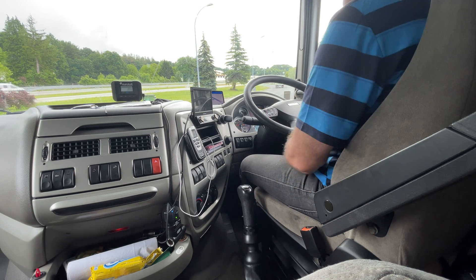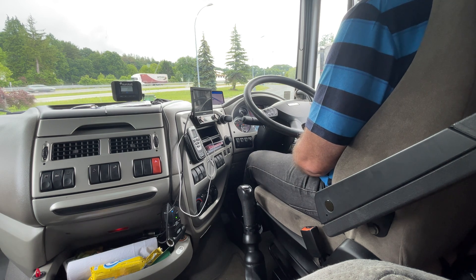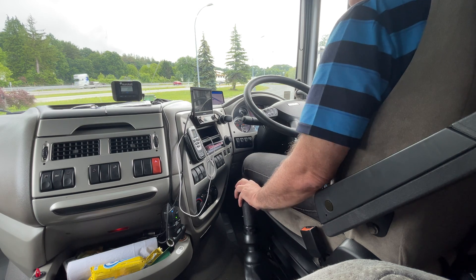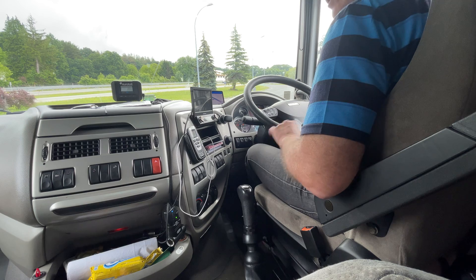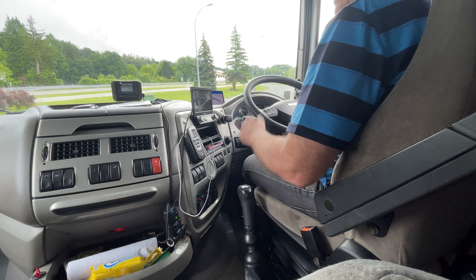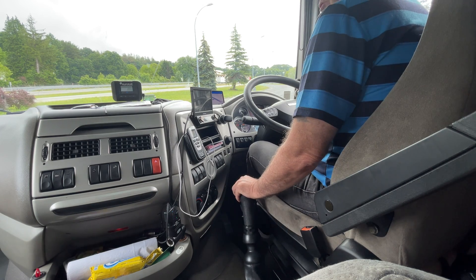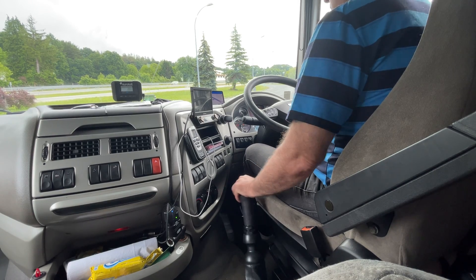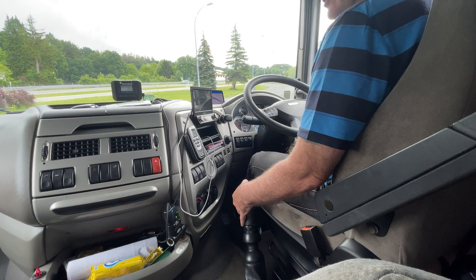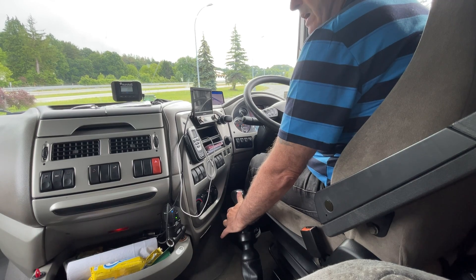You can pre-select the splitter and it won't activate until you press the clutch. So you let your revs die down and then it drops into low gear. You have to remember that it is another gear, so use the clutch accordingly — don't bang it out, because it's literally like starting off and it'll just bang into gear. It's not a heavy load so I can set off in second or even third.